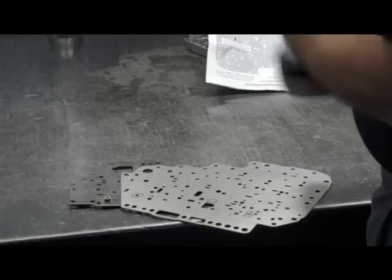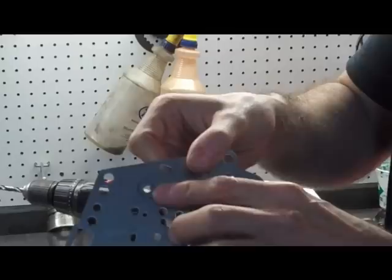Anyway, these are the steps. First we drill that out. And what I like to do is get a bigger drill bit - 5/16ths, 3/8ths, it doesn't really matter - and just kind of touch these hole sides on both sides. So what I've done is put a bevel on both sides because that's going to enable it to hold the plug better.